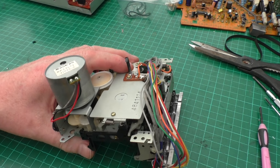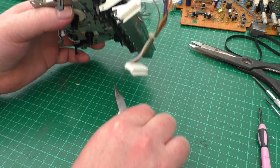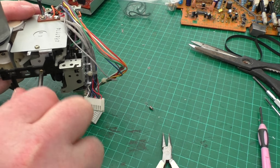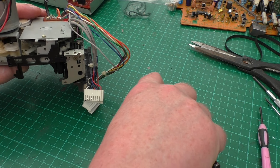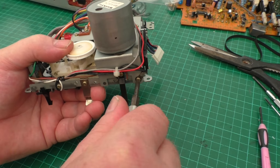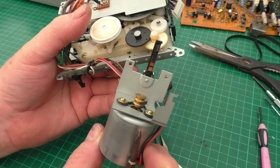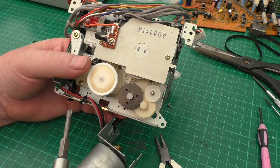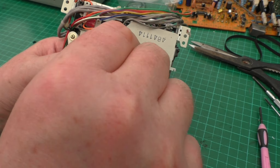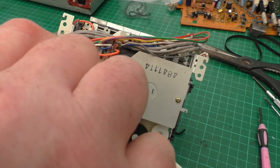On the side, first obviously take the clip up - don't want to lose that, that's the tiny little spring from there. Take that screw out, and there are two screws on the motor. Be careful - there's a little earth tag that allows the motor to lift away. The belts have perished away on this one. The only thing to do is to take off this screw which holds that clip on - it doesn't do anything else other than hold this little bit of circuit board in. Put that to one side and remove this screw.